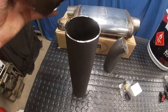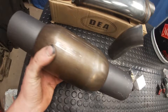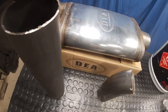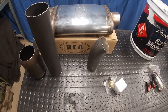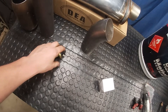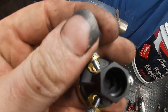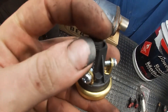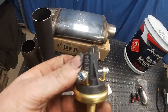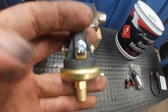This is the same pipe I'm using for my exhaust — I'll just chop it, slide it on, weld it and it'll look like a cat, so I've at least got half a chance of getting away with it. I also got an adjustable pressure switch. You take that little rubber cap off, there's a little screw in there and you can set the pressure for it. It's got normally open and normally closed terminals, so I can get rid of a relay I had to put on for the oil pressure switch I'm using and dial it in for three, four, five, six, seven PSI — whatever I want it to come on at.